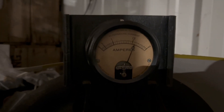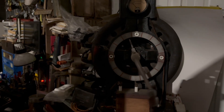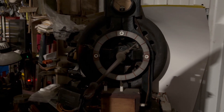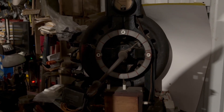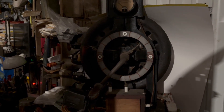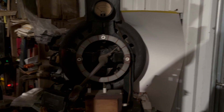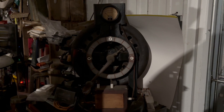Let me show you what the coil's doing. These coils — the magneto puts out about 30 volts AC when the engine is running. You flip it over to battery at six volts to start it, and when it cranks up and is running, you switch it over to magneto and it actually puts out about 30 volts. Hope you fellas enjoyed this about the Model T coils and ignition. Thank you for watching.